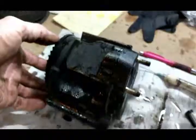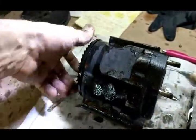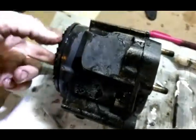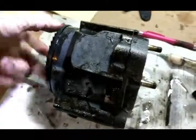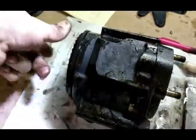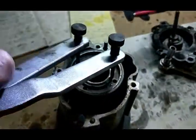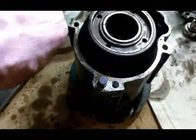I've got the adjuster bolt soaking in acetone to clean it up, and I'll clean up around there a bit — I don't particularly like to leave 30 years of crud in there. I tried using a tool in the holes and turning to remove the ring so I could pull the vanes out, but I can't hold the other end. I tried holding it in the vice but then I could damage the pulley and that would just be bad. So I gave up on that and really greased it up instead.